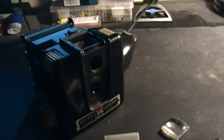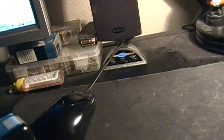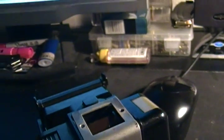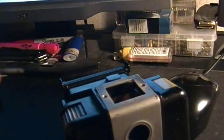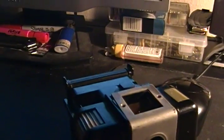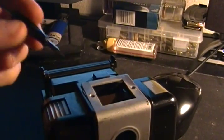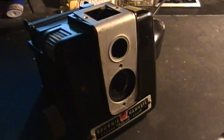I will say it wasn't nearly as easy as what I thought it would be — it was actually a lot more difficult. This piece that goes on here has these two screws up on top. They're about this long, only threaded about a centimeter, not even a centimeter. They were a pain in the ass to get out. What I had to do was use a small flat head, get underneath it and hold it, and then unscrew both of them. If you're worried about scratching it up, you're probably going to do it if yours was anywhere near as difficult as mine.